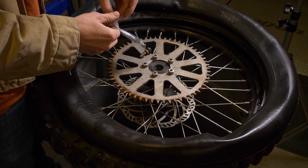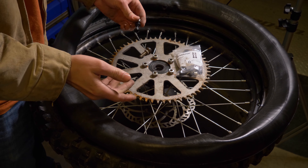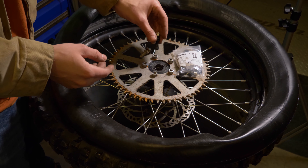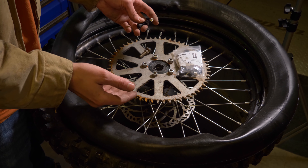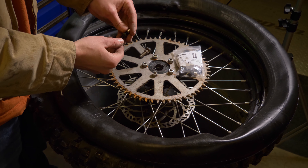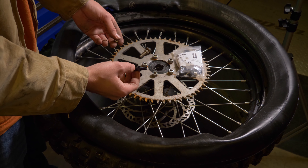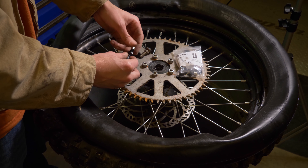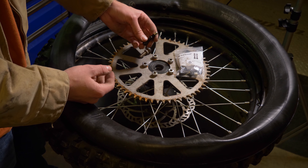I'll tell you guys the differences in valves you can get. The Surron comes with a Schrader valve, and a lot of mountain bikers will switch to a Presta valve, especially when going tubeless, because they like to pedal up hills at 30 psi and drop pressure to 20 or 18 going downhill for traction. There's not really any reason to do that on a Surron since I do the whole ride at the same tire pressure. The Schrader valve works better with an air compressor — most compressors can't fill Presta valves without the right attachments. It's more sturdy; I've had multiple Presta valves break on me. So I would just recommend going with a good tubeless Schrader valve.